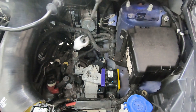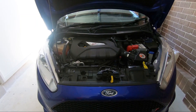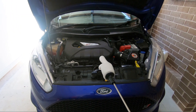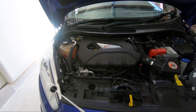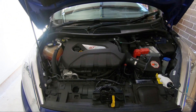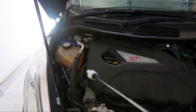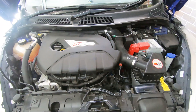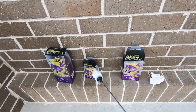That's basically it. We're going to refit the battery tray and all the supporting mounts and the job will be done. This has taken Mitch literally about half an hour including stopping to film. If you've played around with your car before — taken headlights out, replaced your battery and intake — it'd probably take you about an hour. Just make sure you've got a rattle gun and a torque wrench for all the bolts. The Powerflex boxes do come with instructions, so every single one has its own instructions and you can't go wrong. This is the first of my Powerflex install videos — we've just done the driver's and transmission side engine mounts.